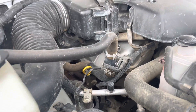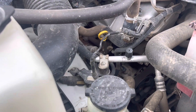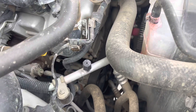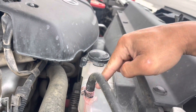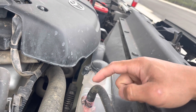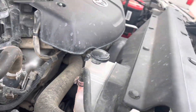I pretty much just check hoses and for any leaks. Make sure there's no punctures. Some of you guys don't really know how to work on cars or maybe even what to look for. But an easy thing to do is just kind of check for spots like this, especially with coolant. You can kind of tell it's dripping. Obviously with oil it's going to be a lot more moist. This is okay though — this is for the overflow tank. Should be fine on the trip, even though it's kind of leaking through the overflow valve or overflow hose.